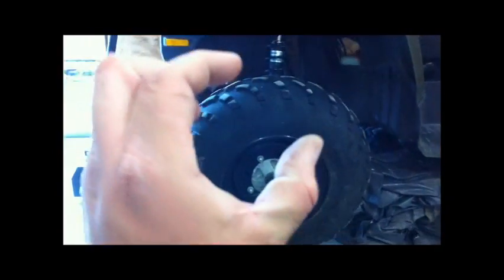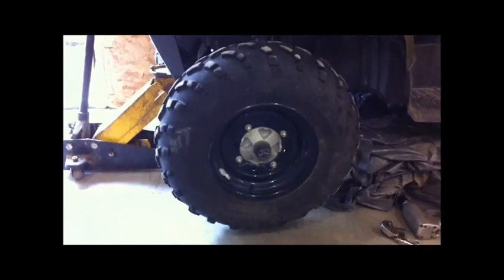It's a double bearing, so it's about that wide, and it's just one single bearing on each wheel, held in by a big C-clip. Just removed a castle nut. Super easy to change — I've actually done a few of them when I was working at my old job.